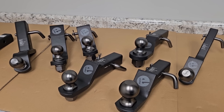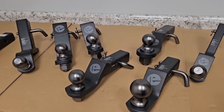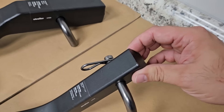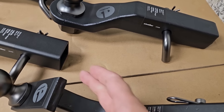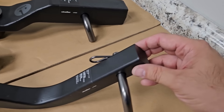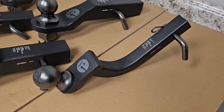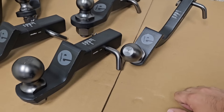It's like a ready-to-tow system. If you order this from eTrailer, they'll ship it to you at a super low cost. They make it for your really small vehicles like minivans and compact SUVs that have a one and a quarter inch shank on the back. This is a solid piece of steel — even though it looks light duty, it's solid compared to some that are boxed. It goes in the rise position so you can haul things with your small SUV or minivan. This has a 3,500 pound rating with 350 pounds of tongue weight capacity.